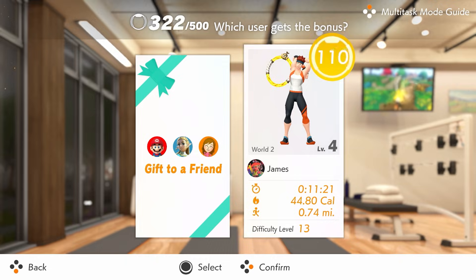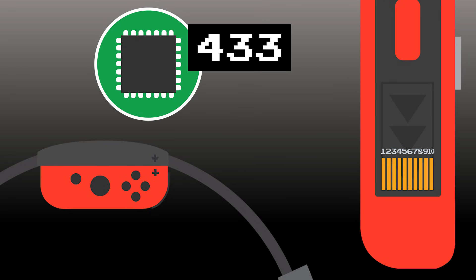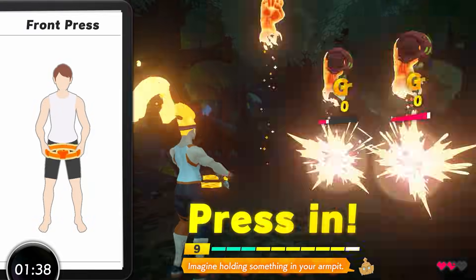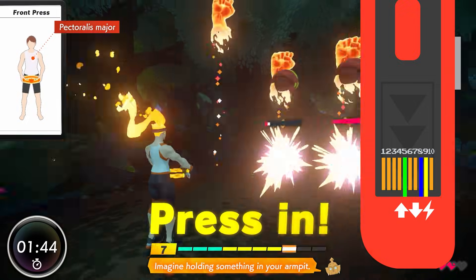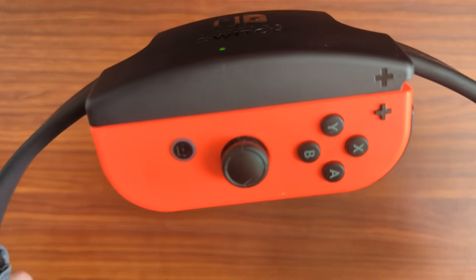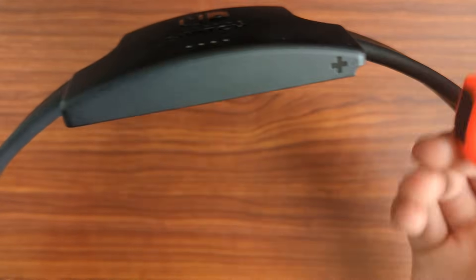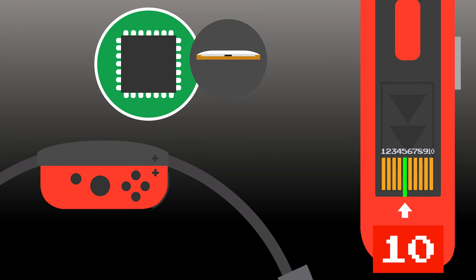When reps from Multitask Mode are submitted in-game for experience points, the rep counter saved on the Ring Con needs to be reset. The Joy-Con is able to send data through Pin 8 on the Ring Con, and the counter on its flash storage gets reset back to zero. Even while connected to a console with Ring Fit open, the pins are actively used to share data. The Ring Con doesn't have an intended way to connect to the console, a gyroscope, or any self-sustaining power source, but the attached Joy-Con does. The console ends up communicating with the Joy-Con, and Pin 5 sends data about the flex sensor's bend.